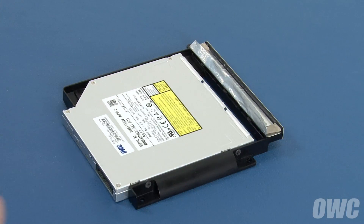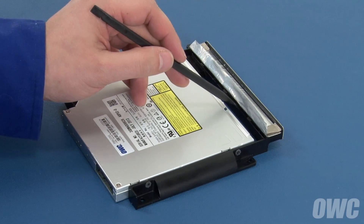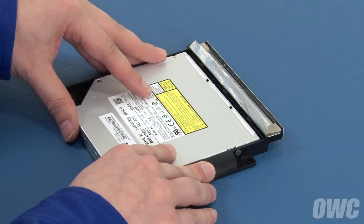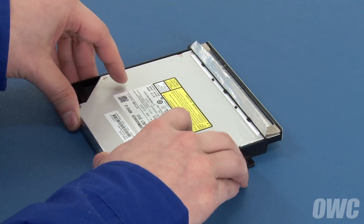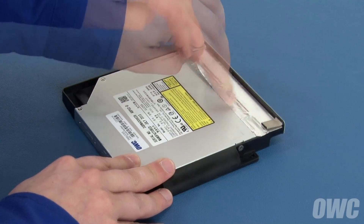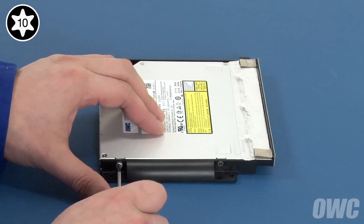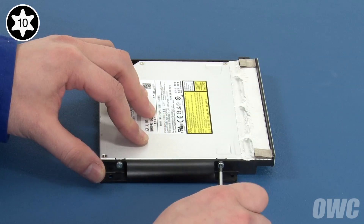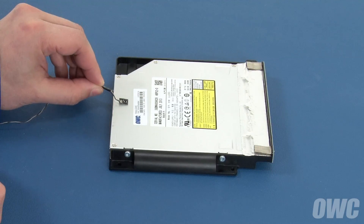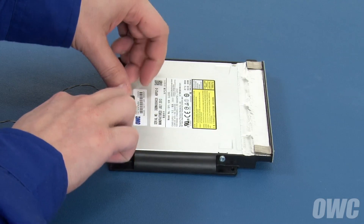Take your new drive and set it most of the way into the carrier. You can then slide the drive forward into place so that the two holes go over the two pins along the front edge of the carrier, while the three circular tabs sit on top of the drive. You can then fold the tape back down and reseal it — there should be enough residual adhesive to allow it to stick. Next, replace the four Torx T10 screws you removed earlier. Finally, replace the thermal sensor and foam pad in roughly the same place they were on the original drive; again, there should be enough residual adhesive to allow them to stick.